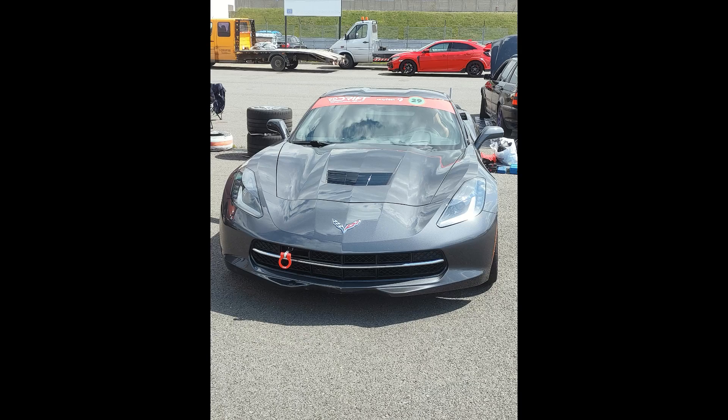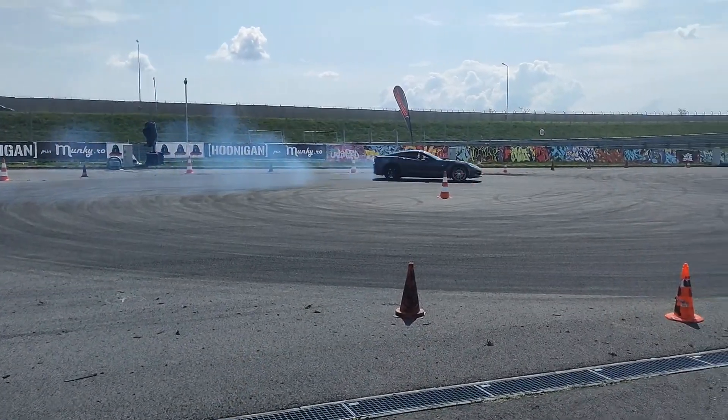It was time to put everything back together, trailer the car back home, get the MOT done, and put it back on the road. So here we are — everything is rebuilt: new clutch, new flywheel, rebuilt axle and torque tube. I hope everything will work out and run great for a long time. If this ever happens to you, on the track or not, keep in mind to check the torque tube axle first before buying a new clutch.